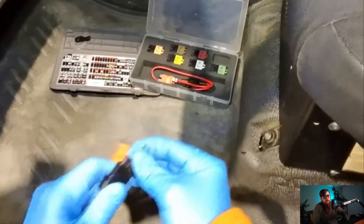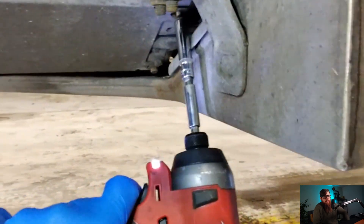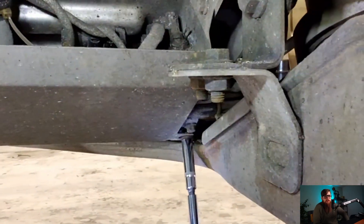Is it a coincidence? Well, we'll have to see. But rather than waste a pack of fuses, I'm going to dig out my short circuit diagnostic kit and fit it in place of the fuse. This cost me a small fortune once upon a time, but I'm now able to supply this a lot cheaper myself, which you'll find on my website over at trucktechuk.com. With the ignition off and our resettable fusing in, it's safe to try and track down the wiring fault.